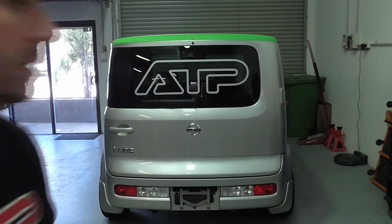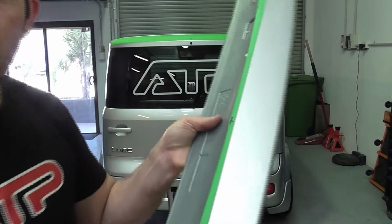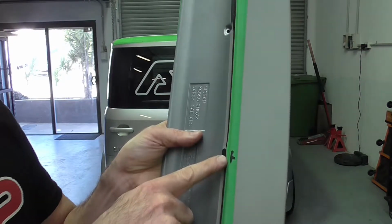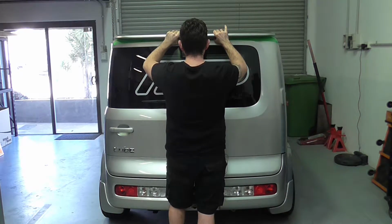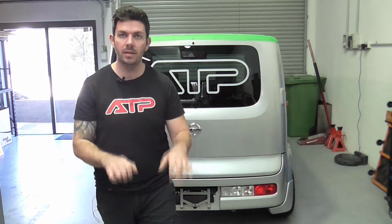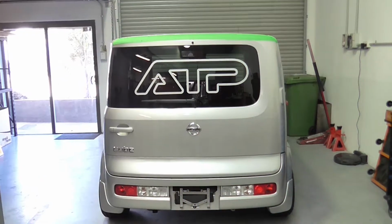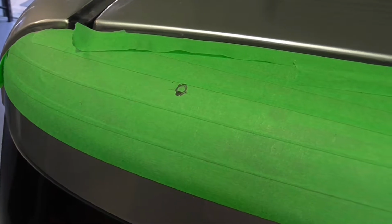I'm just going to press the wing back onto the car using our central mark that we made earlier. So we'll go ahead and we'll transfer those paint dots. So doing that method, you've effectively just made a stamp using the wing as the stamp. And I'll bring you in and show you. So you can see here we've transferred all 4 of those marks across.